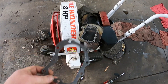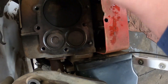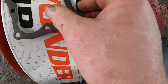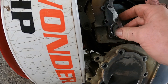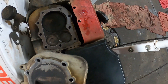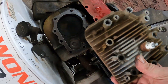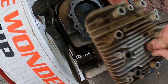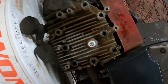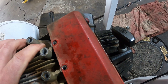We have a new head gasket. What we did is used the wire wheel on a drill to clean the surface up — I don't want to gouge anything. The new head gasket is going to sit down on here just like that, and then the cylinder head will come in here. It's kind of hard to do with one hand — there we go.